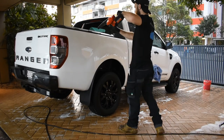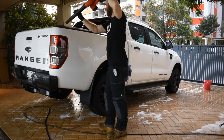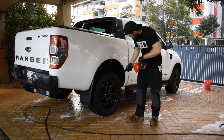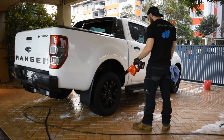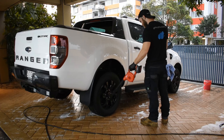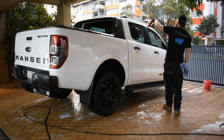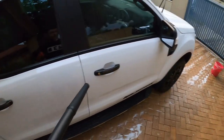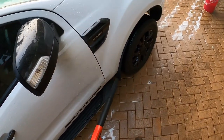There are two really important stages in the wash process. The first is the pre-rinse; the second is doing a proper dry. If you don't dry your car properly it's a write-off — you'll get hard water spotting that can eventually turn into water etching. That's where the high-pH compounds in the water — calcium and lime scale from your tap water — sit on the paint and eventually burn themselves into it. It's most notably seen on black cars.